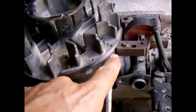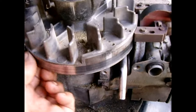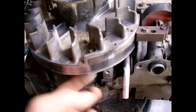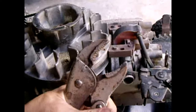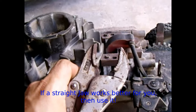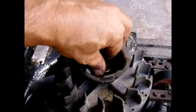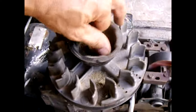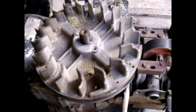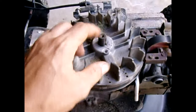Once the nut is off, release the vice grip and take it out. You didn't do any damage to anything — everything's perfect. Now, if you put the vice grip in the wrong spot — the thin spot — you will crack the flywheel, because it's pretty thin on this edge, only about three-sixteenths or maybe an eighth of an inch thick. Make sure the vice grip is in the thick position. Also use a curved jaw vice grip — it gets into the spot easier. The straight jaw gives me trouble every time.